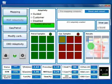And in the other section you see here, there are some red zones and some brighter zones. Red zones mean that here we had a lean mixture, so map adaptivity increased the mixture a little bit here to have a better mixture. And the light blue regions here are regions that have no samples, so regions that are not adapting at this moment.